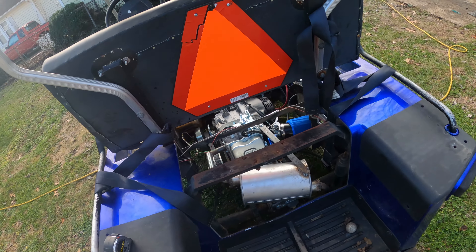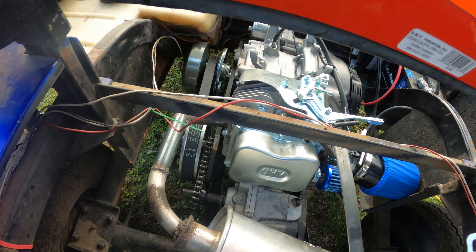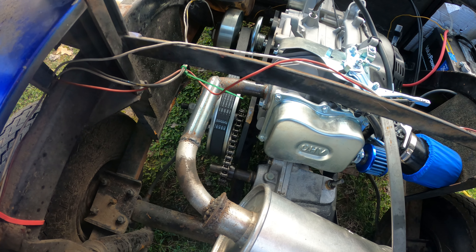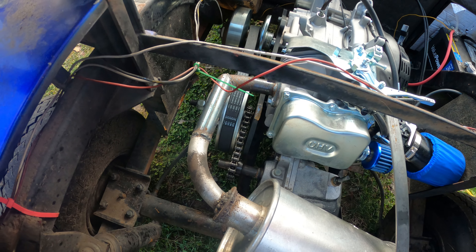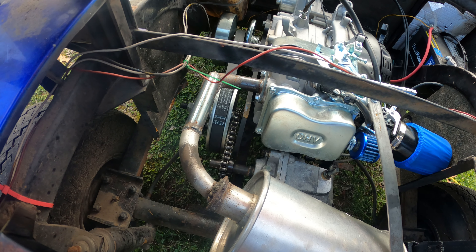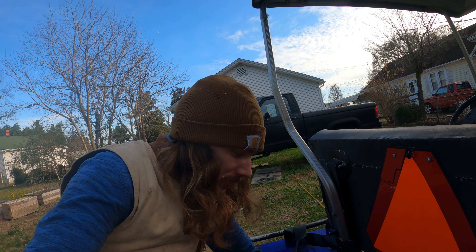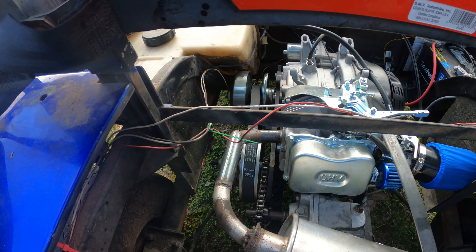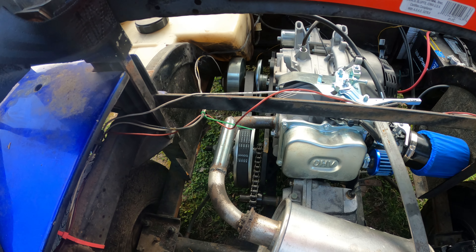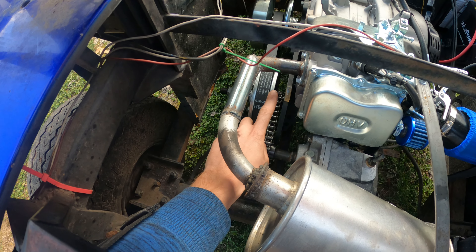I've kind of stumped myself. To make this thing go faster I would need a bigger front sprocket and a smaller rear. I think I can find a smaller rear but it's only gonna be a drop of a couple teeth. I really need to get a bigger front sprocket, which is a Type C — the torque converter sprocket or the jack shaft sprocket. So what's probably gonna happen is I'll have to go out and special order a sprocket. I'll probably just go double the size — the current one is a 10-tooth, so if I got a 20-tooth on there it would be pretty good.